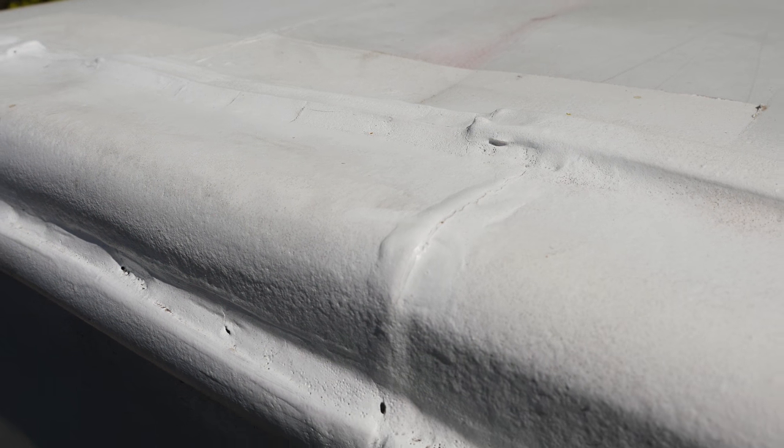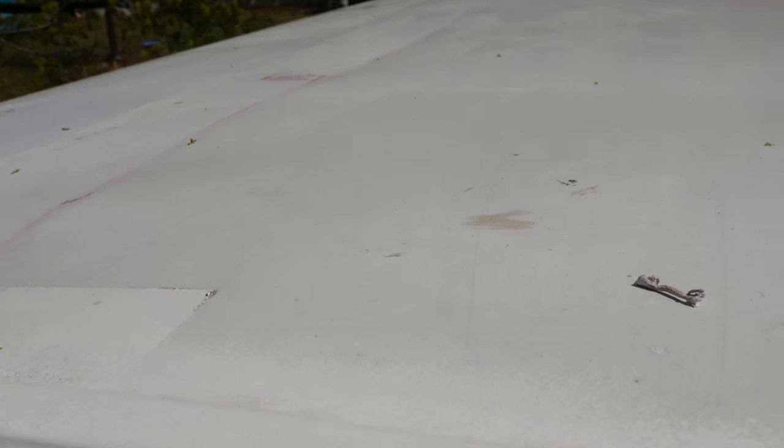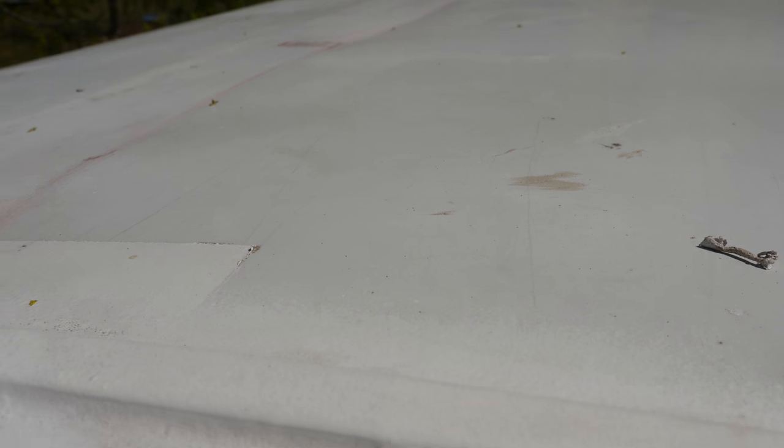This will also get painted with a bed liner product when we're done, but I've got a lot of real estate on the roof to do. I'm not going to bother touching that Flex Seal anymore on this truck — we're just going to remove it, put some proper Dicor down, and get the roof sealed. Right here on the corner, see how that sets up extremely porous? This is multiple thin coats over thin coats and it just doesn't set up well.